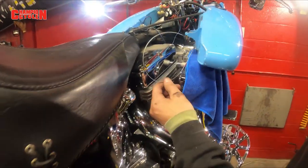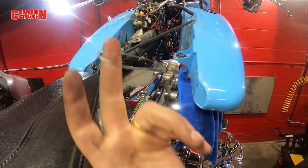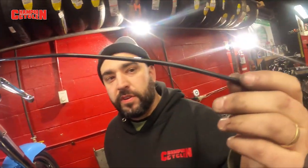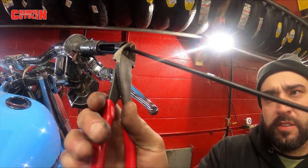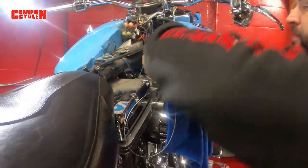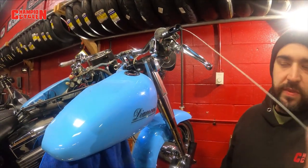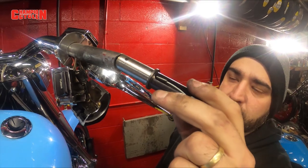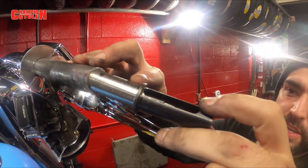Next step — we've pulled our cable up through the bar. Now I've pulled some of the actual throttle cable back out of the housing, pulling it back towards the carburetor, thus pulling it out of the throttle housing. So now at the end of our bar we're going to cut our throttle housing. I'm using some Ultra Sharp Mac Tools cutters. Push the cable back in — there she is. We still have to trim this but we're not done yet. Remember the piece we machined down — our little Exile internal throttle cable unit — we're going to use a form of glue, specifically urethane, the kind people use for windshields on cars.